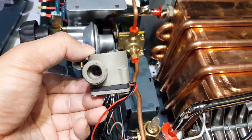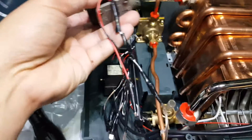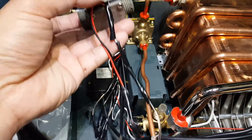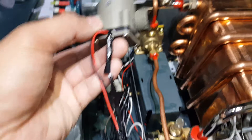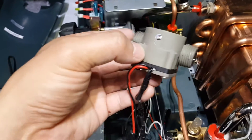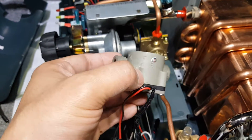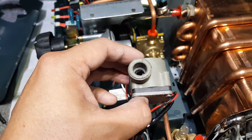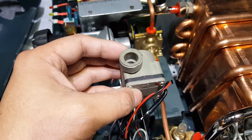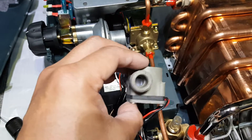I took the water flow sensor off. You're probably asking why there's electric tape on here — it was just a pain to take the unit off from the bottom, so I had to cut the wires to unscrew it, which I shouldn't have done. Unscrewing this from the bottom, there's almost a huge chance you're gonna break it off and ruin the threads on the screw. So unscrew it from the top.